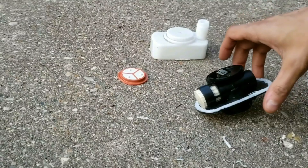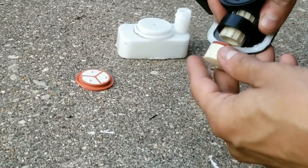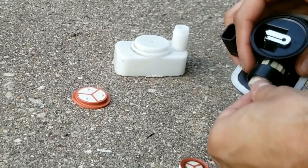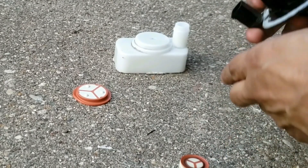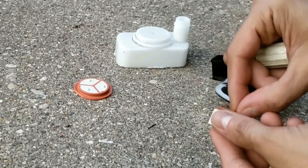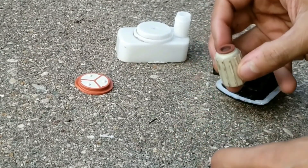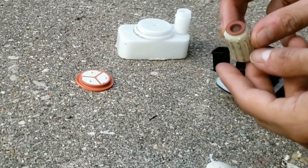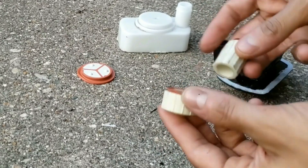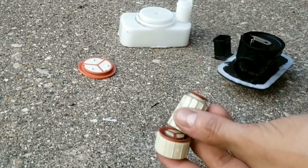Now I'll remove these weights or check valves. This was rattling before, which is normal. The purpose of these weights, also known as check valves, is to relieve pressure and provide vacuum relief. The shorter weight is the pressure relief, while the longer weight is the vacuum relief. The weights use gravity to function, which is why the pump is mounted in such a specific way. The weights could get stuck from dirt, grime, etc. over time, limiting their movement and causing a fault code.